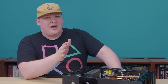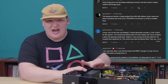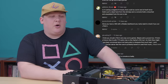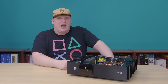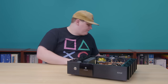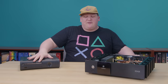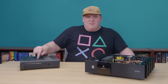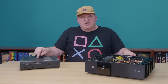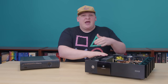I was very surprised by this response, but Blades dash be damned — I got dozens of comments insisting that I should JTAG this thing. In other words, mod the board and install custom firmware that would let me run backups of games I own, but from a hard drive, so I don't need the DVD-ROM. That's a pretty good idea. I could do that, but it's a huge pain in the ass to set that up, so I did one better. You see this 360? This is Chekhov's 360 — I was waving it around throughout the whole previous video, and you probably figured it was just a prop, but it was actually a pre-modded unit that I bought off eBay. My intent was to end the last video by swapping this board into the Edge, keeping everything else the same, retaining the weird cooling system, but just swapping the board for one that can actually run games, and seeing how it would do.